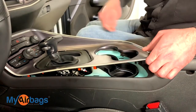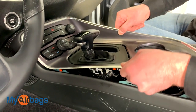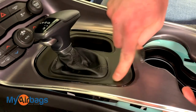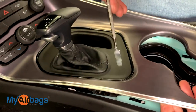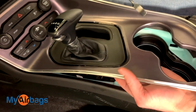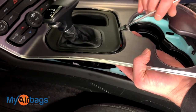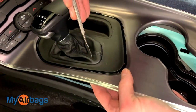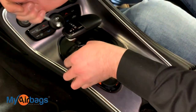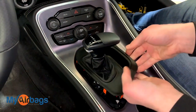You can help it along the way with your tool. Once you get to about halfway, you'll notice that this side is pretty firmly set in, so don't force anything — just leave that right there. We're going to start working on this trim panel here. I like to use a combination of a tool and my fingers from the inside bottom side to push upwards. Push from the bottom up and work the tool in between, just working it up from the bottom and from the side. Be very careful — this piece can break if you force it too much.